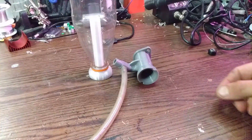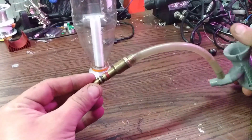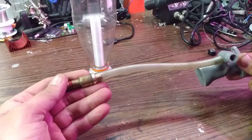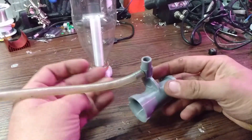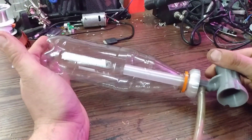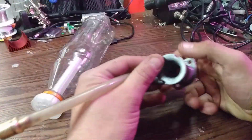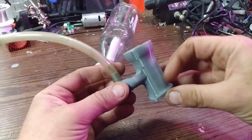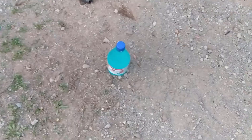This is my intake that I'm going to bolt onto the engine. Starting with the check valve — this is from an oxy-acetylene torch and should stop any backflow or backfire from going into the hydrogen generator. The fuel will come in here, and this may or may not be capped. If not capped, I'll have this on here as sort of an upside-down float ball to store any excess fuel, and it'll be drawn into the intake. There's a venturi inside and the tube goes in there.